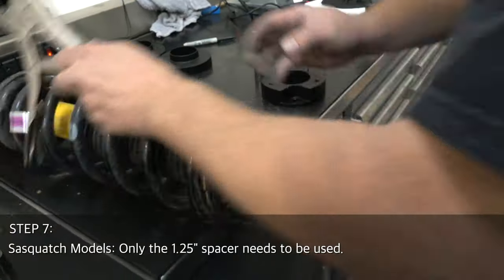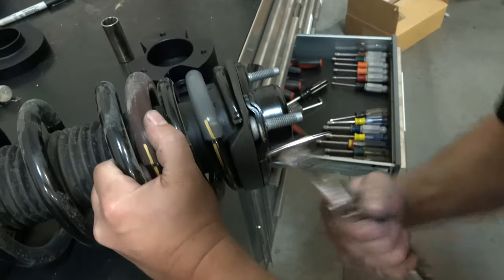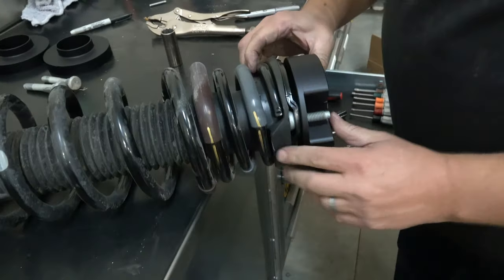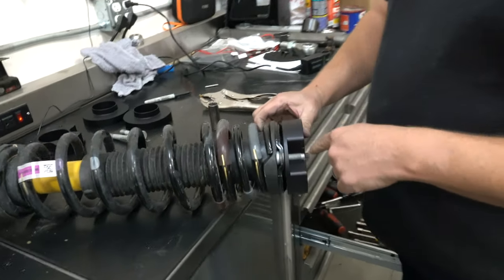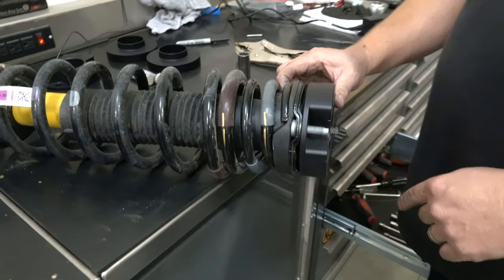We still need to remove this pin. This one has enough clearance for the nuts, so we don't need to cut the nuts off on this one, but we still do need to rotate the upper mount 180 degrees so the new bolt pattern lines up.